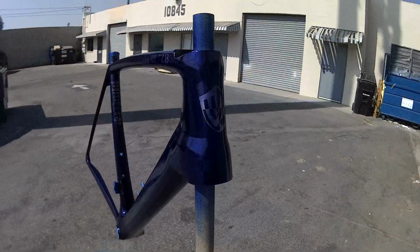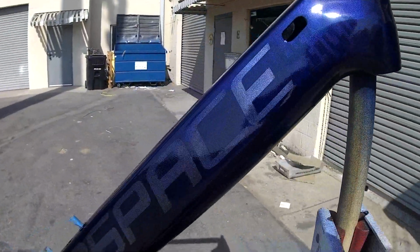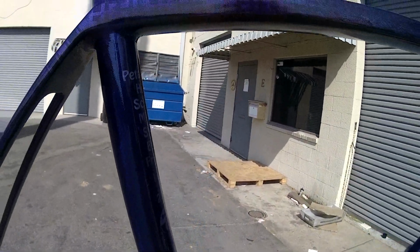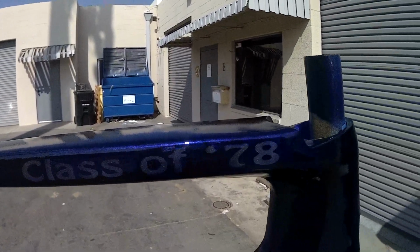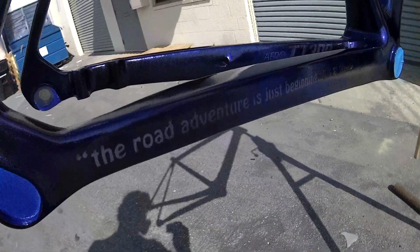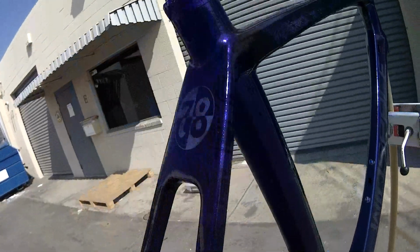Okay, so all that clear coat you saw looked great a few minutes ago, but I had a problem. I ran out of paint. That one can of Spray Max 2K wasn't enough to properly clear coat all of a bike frame. I could have done it if I didn't have to do a fork or the other small parts, and I ended up with large areas that didn't get enough paint to make that wet, glossy surface. So as it is, I had to sand the frame with 600 grit to get the clear coat smooth enough for me to put more paint on.